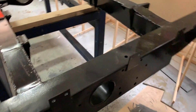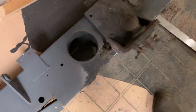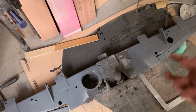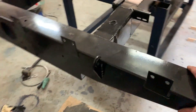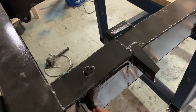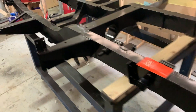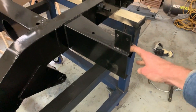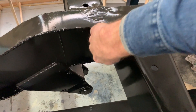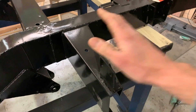There are a number of bits that have been drastically replaced. That was the rear crossmember — and this is the good side, actually. But you can see some big holes here and a bunch of other stuff all through it. It's eaten itself out from the inside, but you can weld on a new one. It comes with these sleeves, and you cut the old chassis off and weld these sleeves over the existing part. We also needed to replace this rear outrigger — sort of the fuel tank hanger as well if it's got a secondary tank. You can see here where it's been welded. What they don't come with, though, is these body support brackets, so you've got to cut these off and weld them back on.